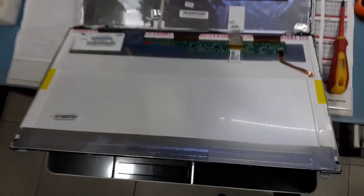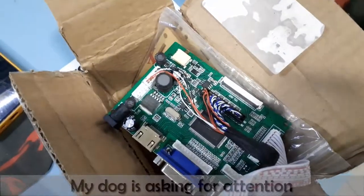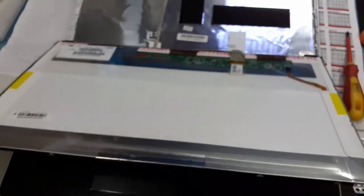These are the numbers you have to look for when you are trying to get the correct adapter for your particular laptop screen. So look for every one of these codes right there, and you send them to the manufacturer, which link I will put in the description down below, and he will send you the correct adapter for your particular display. I believe it's just a matter of coding the correct signals into this chip to work with your screen resolution and everything related to your panel.